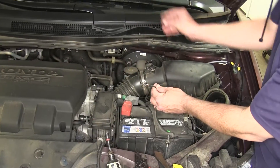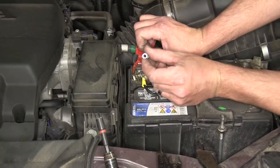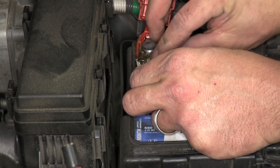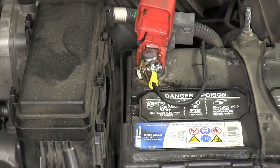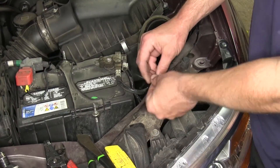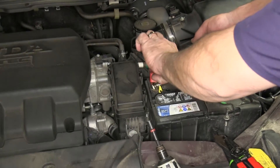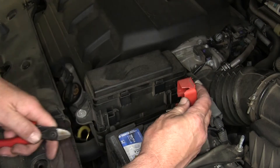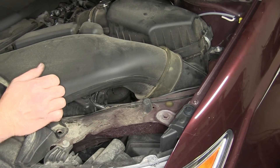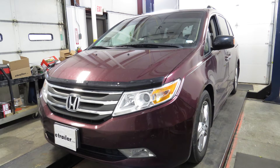Here we'll cut off any excess length, strip back, and add a large ring terminal supplied with our install kit. We can then go ahead and add a 6mm nut and put the ring terminal directly on the end of the manufacturer's positive battery terminal post. Once we have it installed and secured, we can go ahead and secure our wiring with the black zip ties, cut off the excess from the zip ties to clean up our install look, and tailor our positive battery post cap to go around our wiring. Reinstall the air intake, and that'll complete our install of hooking up the power circuit for our 7 pole connector using the e-trailer install kit part number 5505 for our 2011 Honda Odyssey.